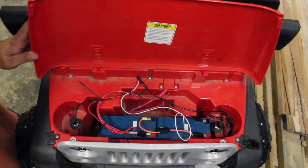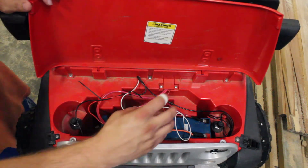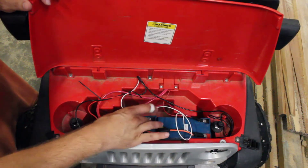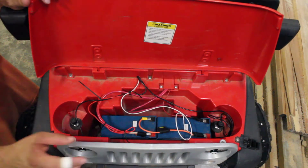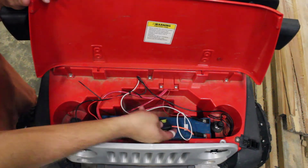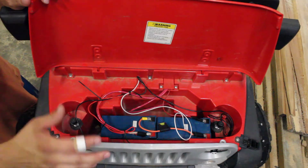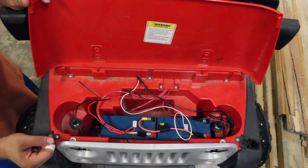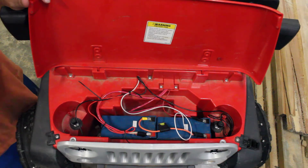I made it 24 volts. You can see the original battery compartment in the middle — I cut some of the plastic out and was able to fit two 12-volt batteries in here, connected in series with a fuse. I did some rewiring and wanted to bring you along for these modifications so maybe it can help you out.